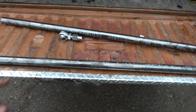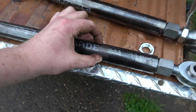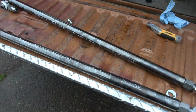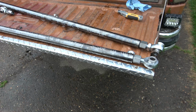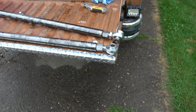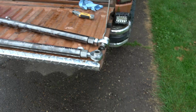And that's it. So now, like I said, we'll be pulling on this part of the knuckle instead of pulling on right here. Going from here to here gives us about 3 inches. And then with some adjustment that we have at the steering box, we can get this drag link to the exact same length as our track bar. And like I said, that should get rid of about 99% of my steering or bump steer. This is gonna be pretty cool.